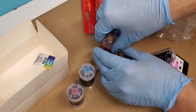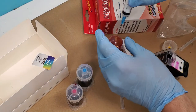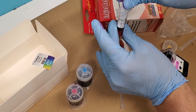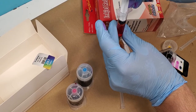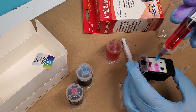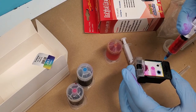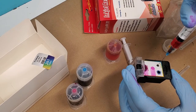Close that so we don't mix anything up, then open the yellow and do the same thing with the yellow ink. Just make sure the syringe is empty first. For yellow I'll do a little bit more since I know it was the first one to go, so I'll do four milliliters. You can see the mark on the side — four milliliters. Don't worry about the air or anything like that, because that's something we'll handle after we refill.